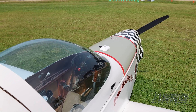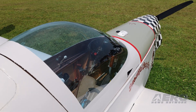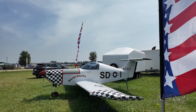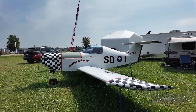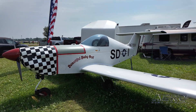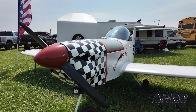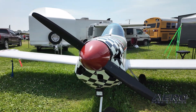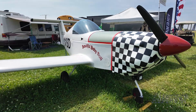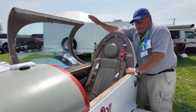Performance with the engine we're using right now is about 85 miles an hour. Cruise can be pushed to 100. It's a 35 horsepower engine — an inverted 35 horsepower V-twin manufactured by Briggs and Stratton. There's a dry sump with an external sump. We put an oil pump on the camshaft and the sump is negatively pressured when the engine is running so that we can scavenge oil from the bottom of the engine and also from the valve covers.